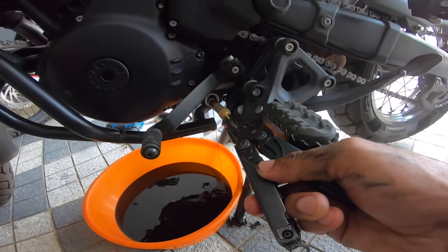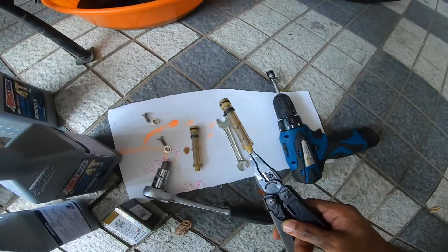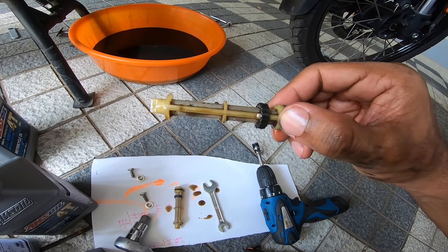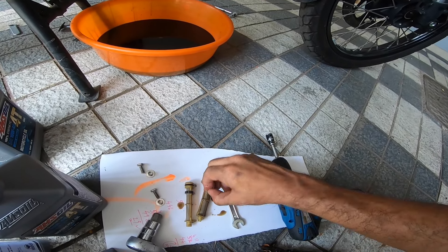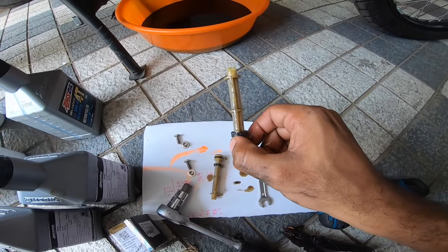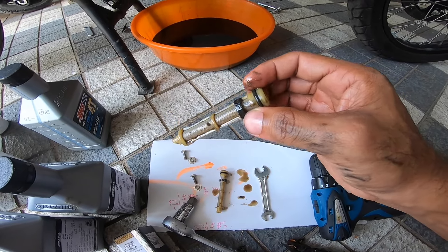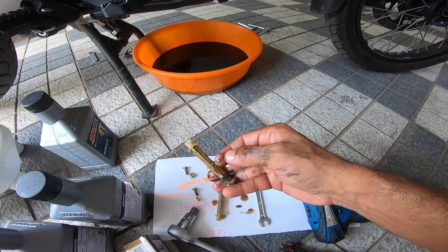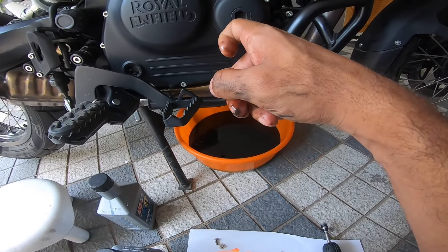The strainer should give you a clear indication of what is going on inside the engine. Look at all that metal debris — so many micro metal particles. There appear to be some plastic strands as well. There is a lot of metal residue here, and all kinds of materials — could be from the clutch, could be gasket material. I see some blue material here — that could definitely be some gasket material — and then some serious metal shavings. We'll wait for all that oil to drip, and then it will be time for the oil filter.